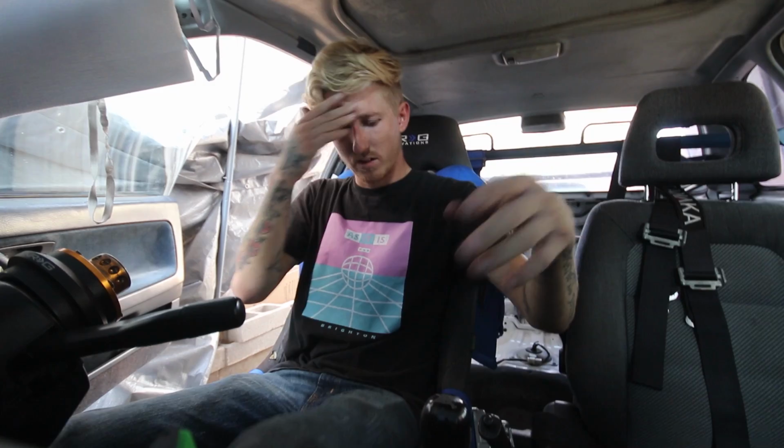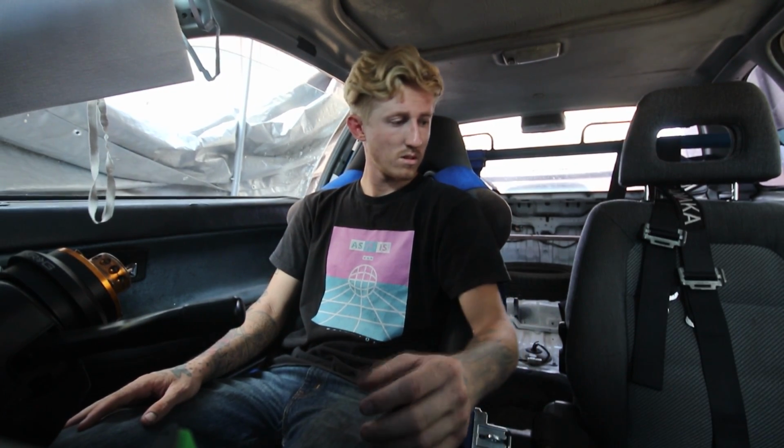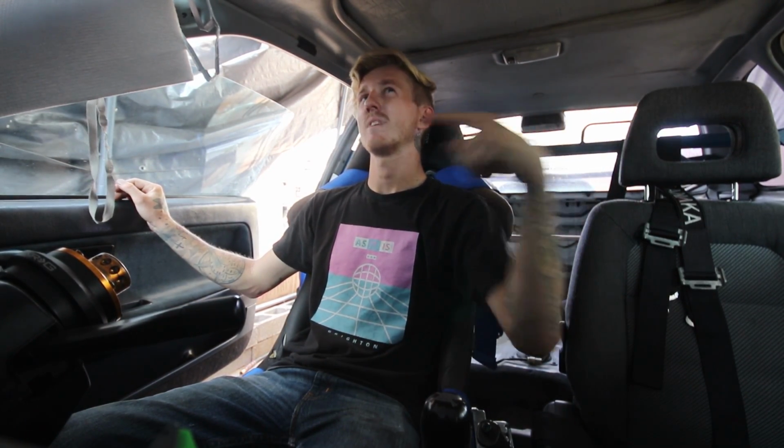But it's on. Alright, let's try and back this up off my block and see how this thing feels. Oh, is there another brick back there? I think there's another brick behind me. Oh yeah, can you pull forward a touch? Alright, you good? I'd say it feels pretty good. I think I need to adjust the pedal push rod just a little bit in, because the pedal is a little close to the floor. But yeah, it's got pressure.